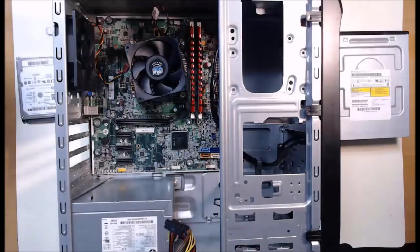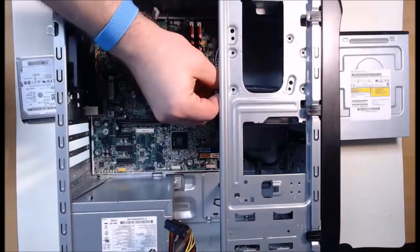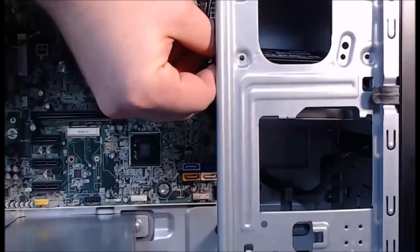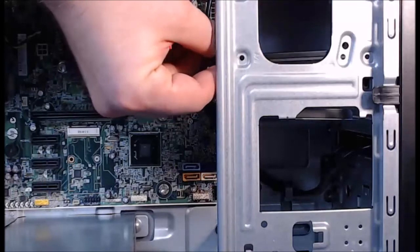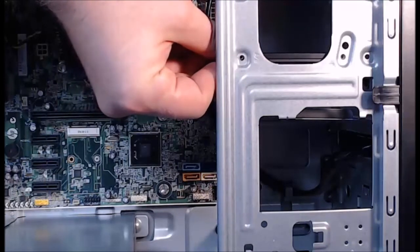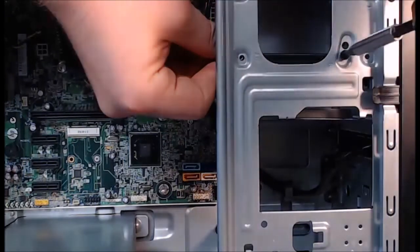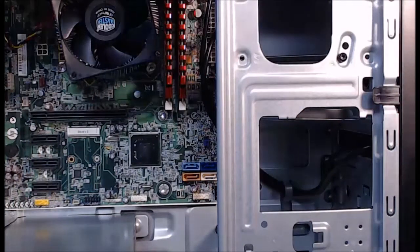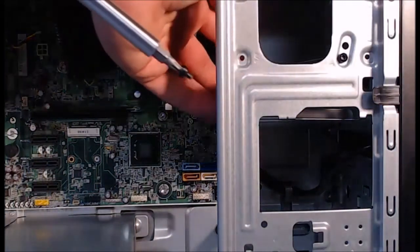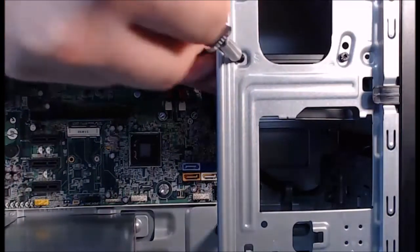When I line it up with the two screws, which we'll be able to see, there's many different screw holes on the side of these, we need to align it up perfectly with a set of the holes. Now for me, my 2.5-inch hard drive lines up beautifully right here. And then I can do my second screw. My 2.5-inch solid state hard drive is installed.